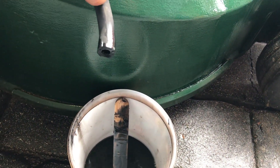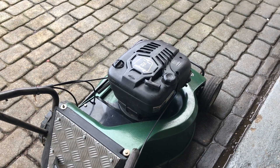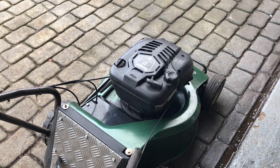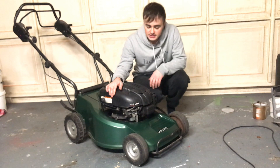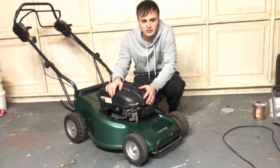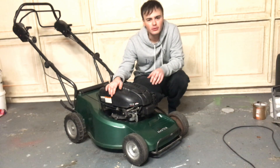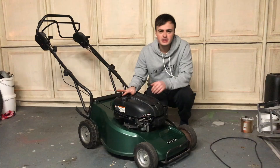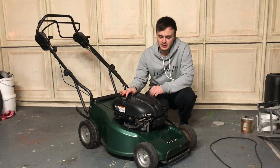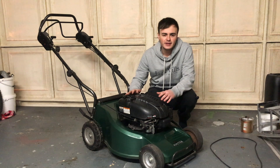I'm going to be putting it back in storage over the winter. I'll get it back out in the summer, but I'm just draining the fuel out. I drained off all the excess fuel and burnt off whatever's left in the carb, so now I can store this knowing that the carburetor is not going to get all gummed up or blocked with old fuel. Just to put things into perspective — this is a really big lawn mower, I'm not just a really small person.